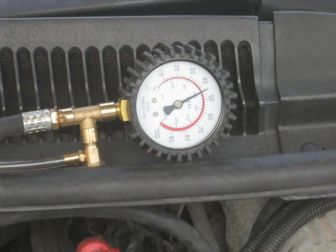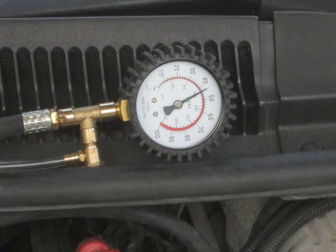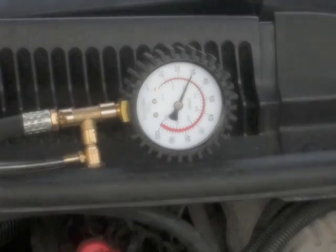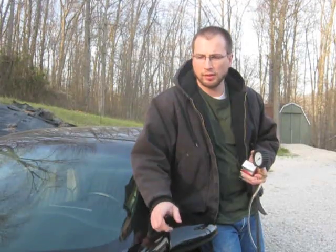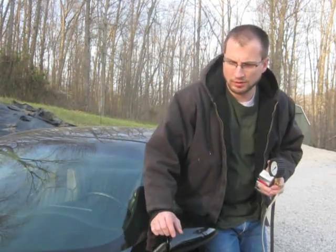So I'm glad I found this out. It's definitely not the check valve. It's definitely not the pump. It was the regulator the whole time. About 15-20 minutes later, it's still holding some good pressure. I certainly didn't think I'd be doing two videos on a fuel pressure regulator, but that's really what ended up happening. I found low pressure and quick bleed off, and my initial thought was fuel pump — bad check valve and possibly a hole in the line.